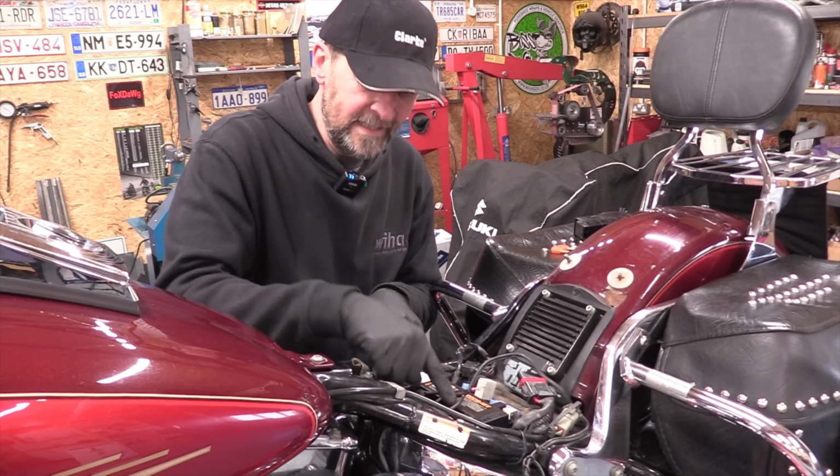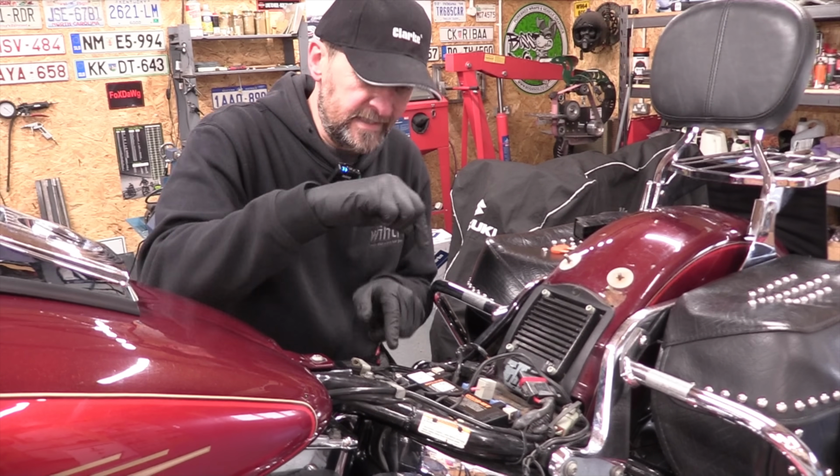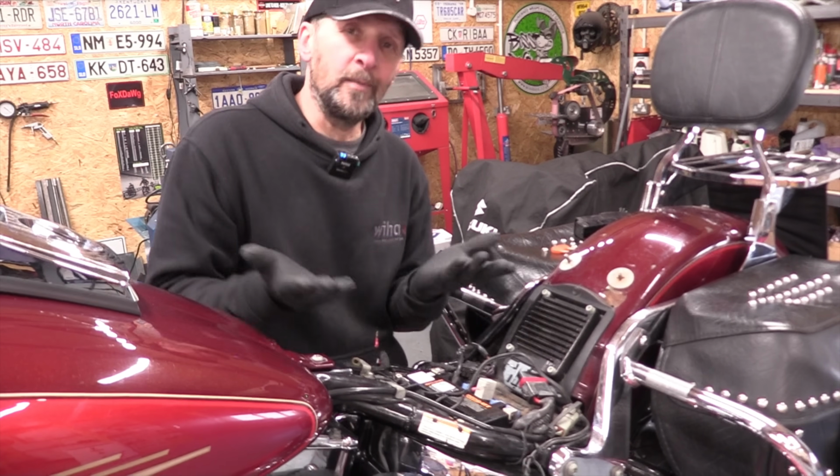So too many tabs is a bad thing, but with the Motobatt, with those 4 terminals, I can have my main connections to the bike on their own, with a maximum amount of screw thread down into the battery, holding them nice and firmly for good. And I can just put all my accessories on the other 2 terminals. How common sense is that?